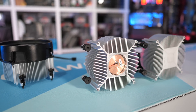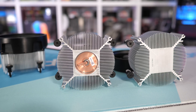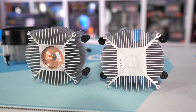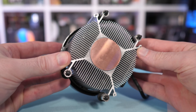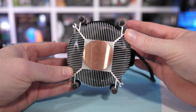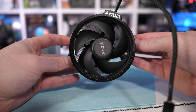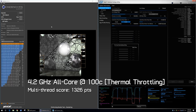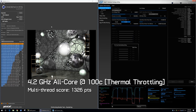At the end of the day, they are providing an inferior cooling solution compared to the original Wraith Spire, which is quite disappointing. I hope AMD doesn't continue moving in this direction to maximise profits as they become more competitive. For now it's somewhat of a non-issue as I recommend avoiding the R5 3600X at $250 and instead grab the $200 R5 3600 and spend $20 to $30 on an aftermarket cooler to improve thermals and lower operating volume. For those who might say I'm going soft on AMD — it's pretty unreasonable to give AMD a hard time about this change, given the cooler still works quite well and is miles better than what we get from the competition with much more expensive processors. For example, the Core i7-8700 isn't just loud and hot with its box cooler — it also throttles heavily, even in a 21-degree room. So AMD is still some way off screwing us quite badly, but let it be a warning to them: we are paying attention.